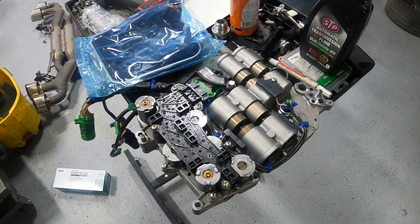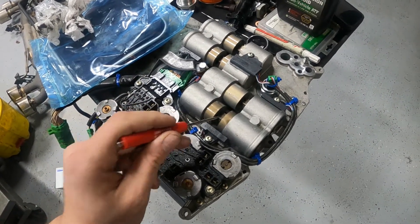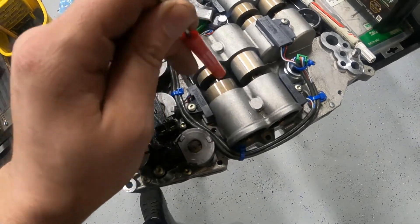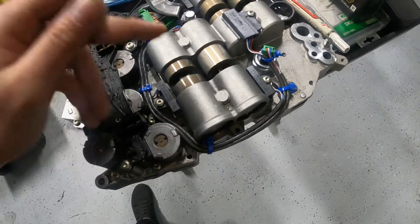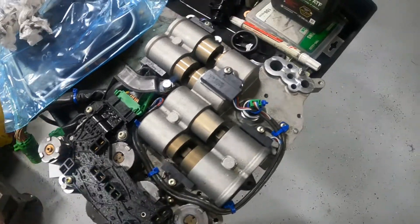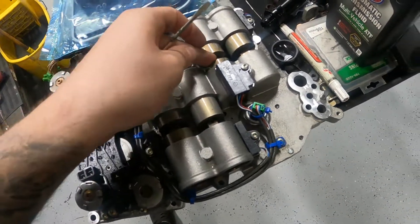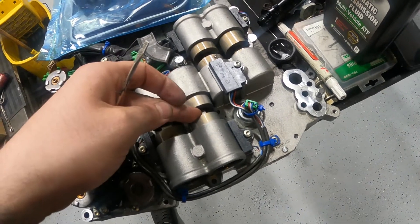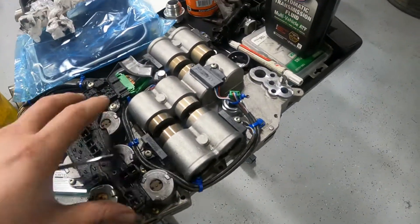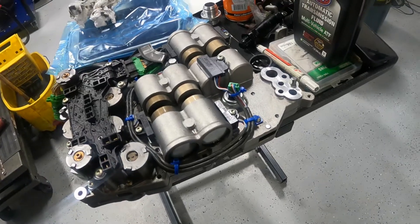All right, we're back. One other way — aside from seeing where debris has collected — to tell how these shift pistons are supposed to line up: get a small pocket screwdriver or any magnet and you can feel where it is actually magnetic. This side is magnetic, this side is not — meaning the magnetic side has to line up with the sensor. I cleaned the pistons from the surface to check how they're moving in and out. One is fine, one is okay, and one is very gritty. We're going to take the circlips off, take the pistons out individually, clean them, and reassemble them with a little bit of trans fluid so they can move in and out freely.